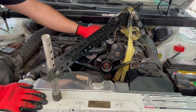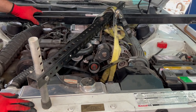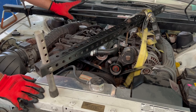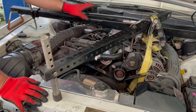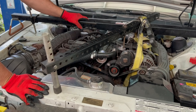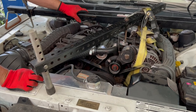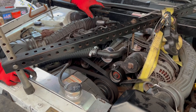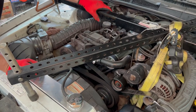This one's got a little extra leg which gives it a little more stability — you put that on the core support. I have a steel cable around the alternator bracket, and I kind of put a ratchet strap around the bottom of the power steering bracket. Just so everyone knows, this is not the only thing I'm using to hold this car up. We're putting this car on the lift, going up in the air. I'm going to use a tall jack stand to hold up the transmission. So this is more a secondary hold-up system, not the primary. Super Coupes are kind of hard to find good places to hang things on because there's a lot of stuff there.